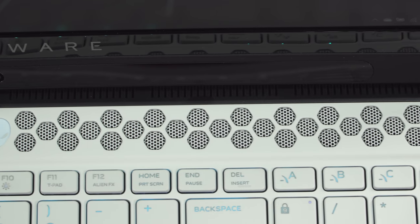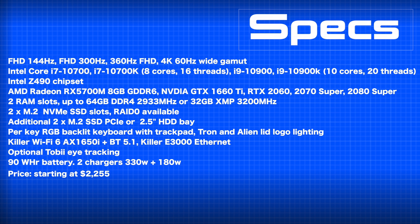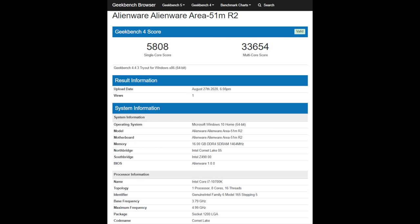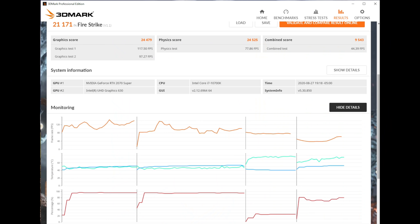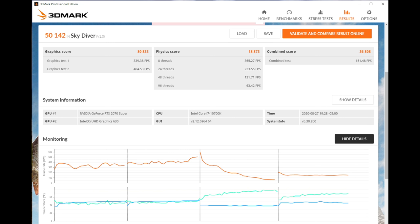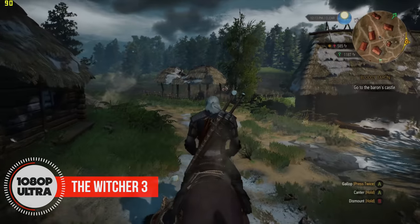For those who watched our original Alienware Area 51 video, the big promise was an upgradable laptop — something we hadn't seen in decades. This uses the Intel Z490 chipset, which the next 11th gen Rocket Lake CPU should also use, so in theory it could be compatible, though BIOS support is uncertain. You could upgrade within the 10th gen range, say from Core i7 to Core i9. For graphics, upgrades are limited to the RTX 20 family — there's no promised path to RTX 30 GPUs. You could use an Alienware graphics amplifier or Thunderbolt 3 external GPU for that. So take the upgradability with a grain of salt.